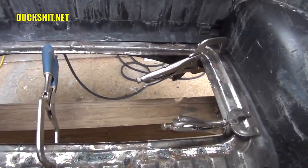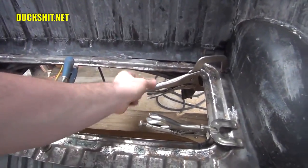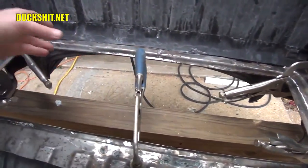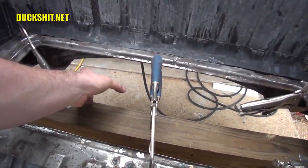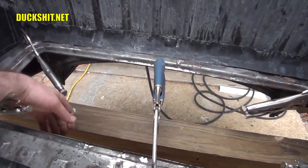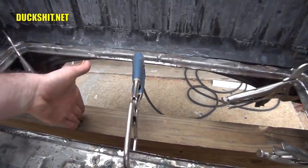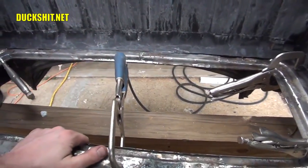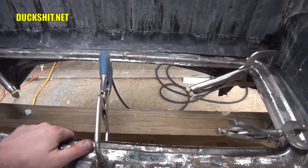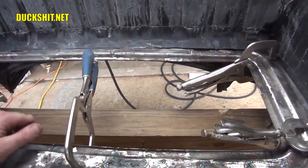Oh, I'm really liking this. The clutch cable would be right over here. The wing nut would be real easy to get to. The starter motor will be right here. Again, really easy to get to. The wires will probably be approximately right here, so I can easily unbolt the wires and then pull the starter out. CV joints will be right about here and here. The top engine bolt, the one that's really, really hard to get out, will be right in front of the wing nut, right over here, for the clutch wing nut.